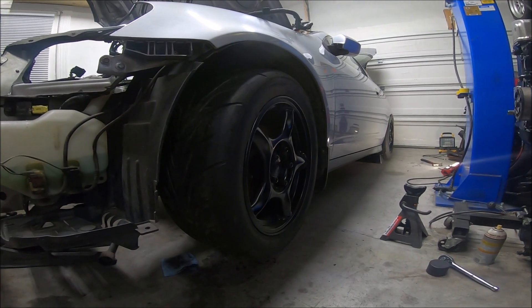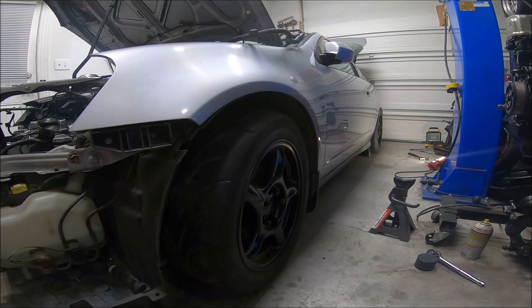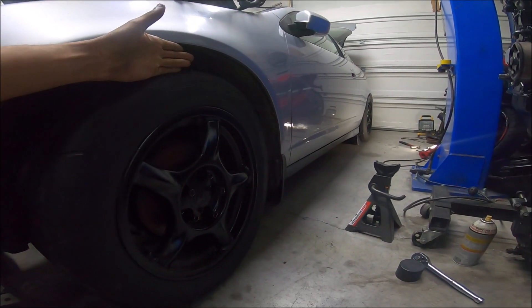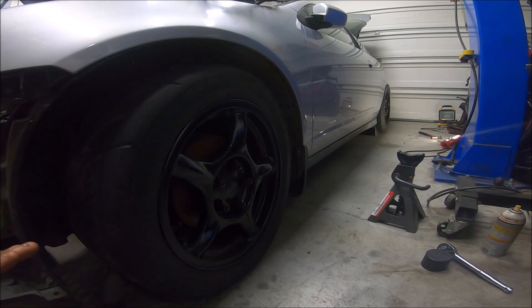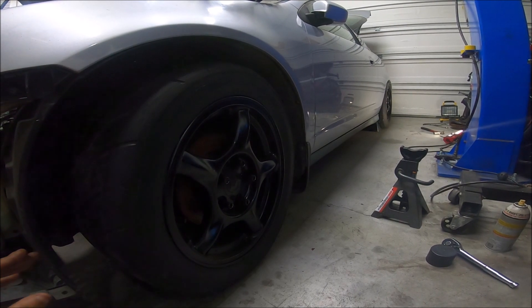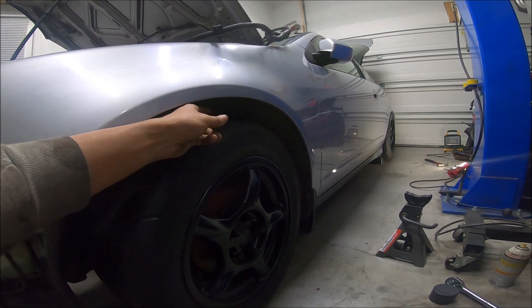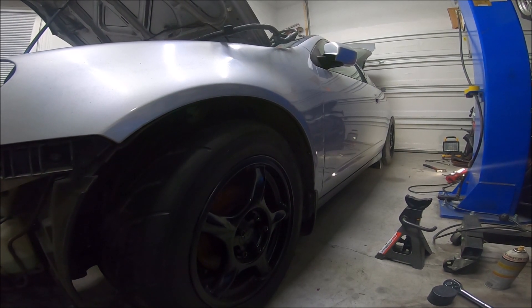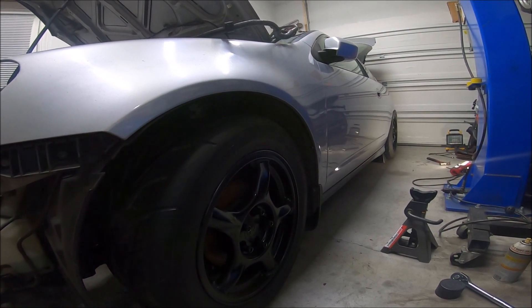Got the wheel on. Let's jack it down and see how she looks. Still a little bit of a gap — about three fingers worth — but there's no motor in here yet, so we don't know how much the car will drop when the motor goes in. I might just leave it here for now. Realistically when you drop the motor in you'll lose about two fingers of gap, which should put us right about on the wheel. I think we might be good right here, but who knows what we're doing next video.